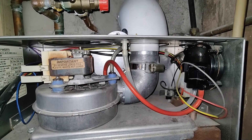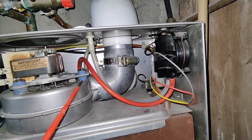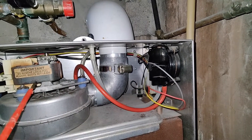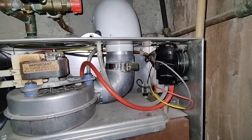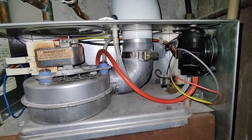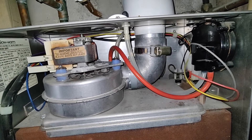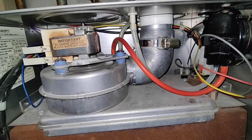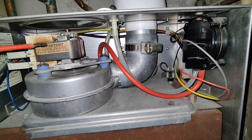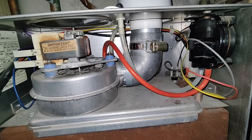So I'm going to need to change these bearings. To remove the fan there's a clamp there and some electrical connectors here, and once that's out of the way we can disconnect here. This is the air pressure switch as well — disconnect these, take a note of where everything goes, and we'll be able to take the whole fan out and then separate the fan housing from the motor itself. I'm just going to give this a little start up to see how the fan reacts and see if we can hear the origin of the noise, then power down again.